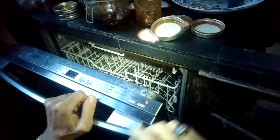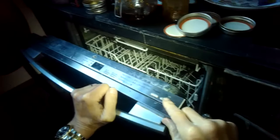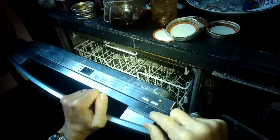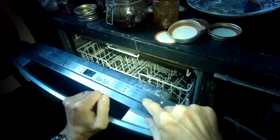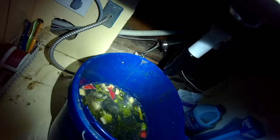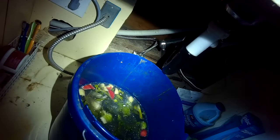I'm gonna get some of the water out by making it drain as well as it can. I'm gonna press the power button again and then pick a new program. When you switch to a new program different from the last one it ran and then close the door, it'll activate the drain cycle and should drain out all the water. If you're not able to drain any water you may have to bail it out, but this one is draining just maybe half as much water as it should. I can hear it kind of dribbling but not pumping out water as fast as it should.